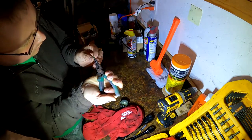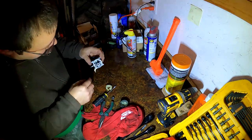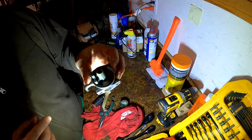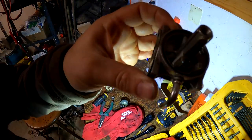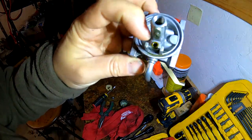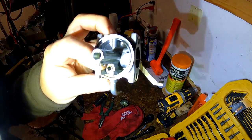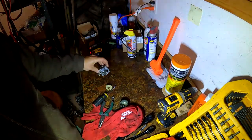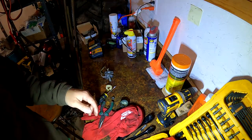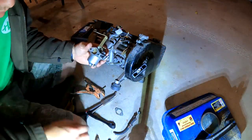There it comes. There's no way that thing was getting gas, because when your needle's stuck in there, ew. She got ethanol-y. You ain't gonna be able to see it, but in here it's green. Green and gooey. So I'm gonna get the air compressor going and spray everything out with air, clean it, and then you'll be back. All right, carb is clean.